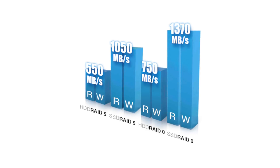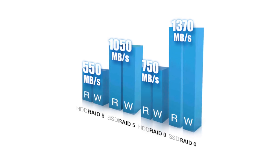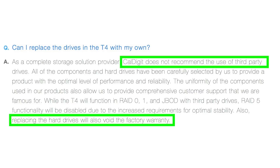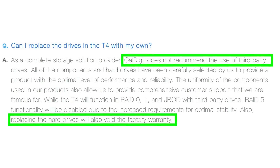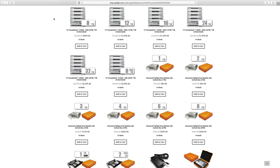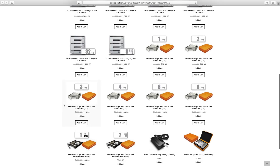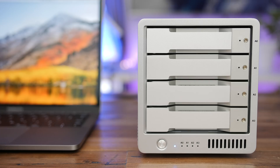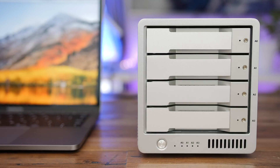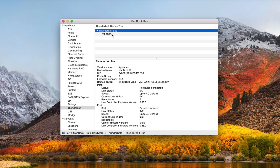What should you expect from the different configurations? With a RAID 5 like this setup, around 550 megabytes per second. If you're using SSD RAID 0, you can expect a lot faster. CalDigit does not recommend using third-party drives — in fact, replacing the drives will void the warranty. They will also disable RAID 5 in the disk utility when you have your own drives installed. The good news is there are lots of different drive configurations available, ranging from around $800 up to $3,500 depending on your needs.